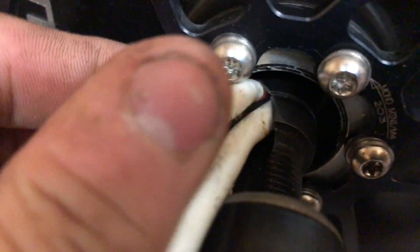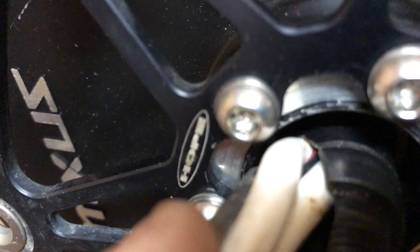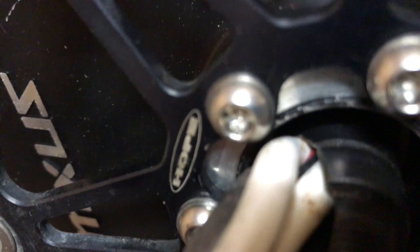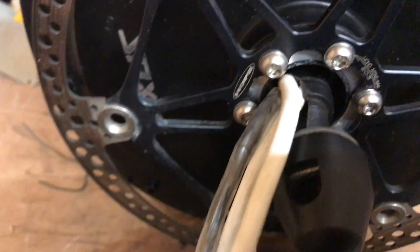Another thing was getting all these wires through here - if you look down there, it's very, very tight, and there's not much clearance between the outer rotating part and the wire, as you can see. It's only about 1-2 millimeters, and they can't touch it at all, otherwise the wire will get sliced up and my entire bike will become live, which is not what you want.